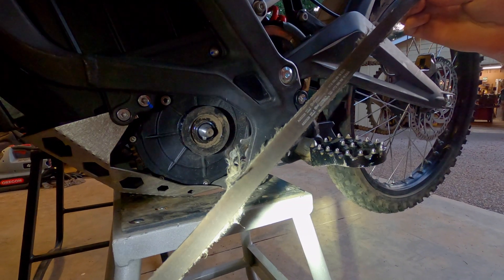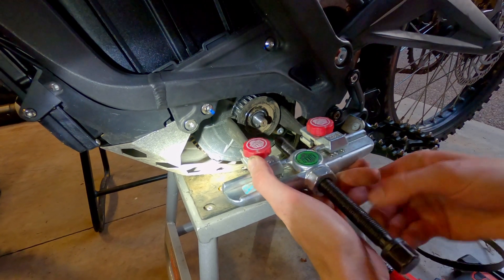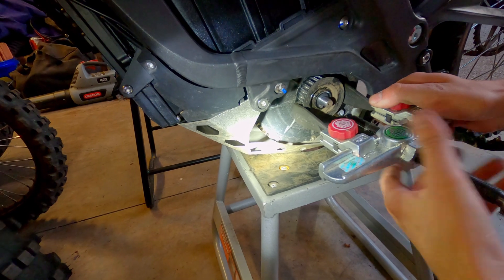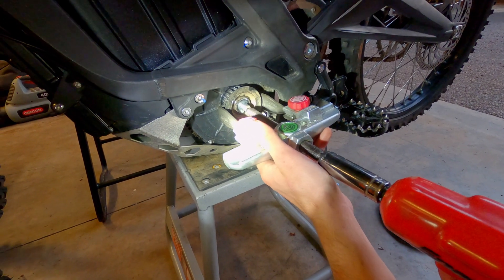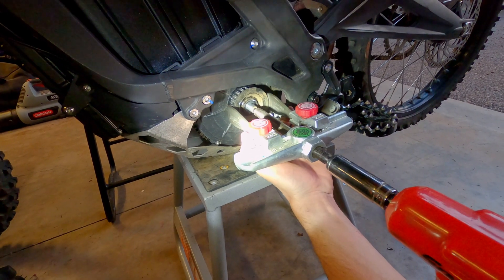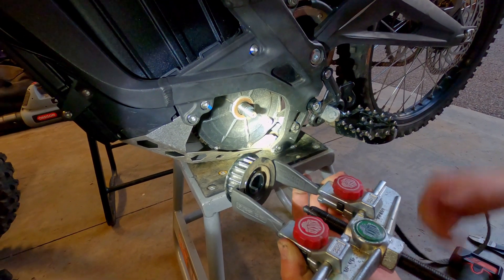Here's what a stripped belt looks like — nothing too special, but as you can see it is completely gone. The next step is to remove the belt pinion sprocket, and to do that I used a puller with an impact and it came off pretty nicely. If you don't have a puller I would recommend buying one, just because it's going to make your life much easier and you have it if you need it for anything else. But if you just will not do that, you could try coming at it with a pry bar or some sort of slide hammer.